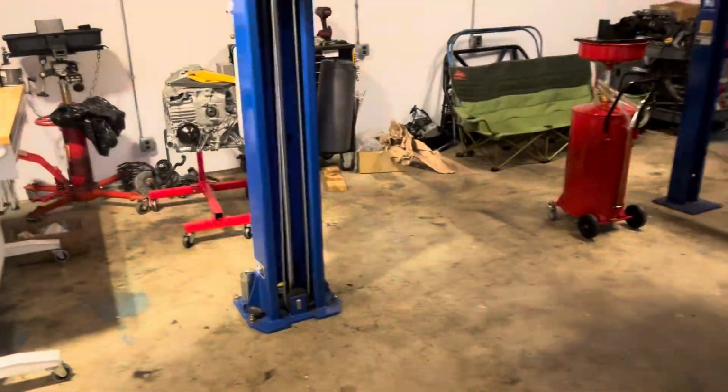But if you ever get to the point, Tom, where the car is riding really rough, or where you'll notice it in particular is if you're in like a supermarket parking lot and you go over some speed bumps and it just feels rough, or I'm sure you've been in a car with bad shocks. Usually these shocks, they start going bad by age, not really mileage. So in the future, that could be something you might want to consider upgrading if it's affecting you. I did drive the car, it feels fine to me.